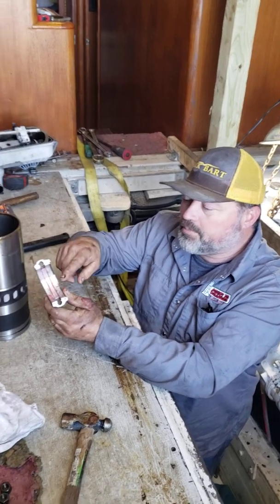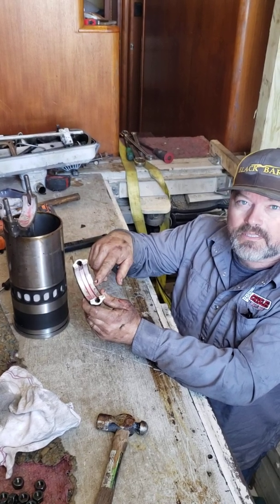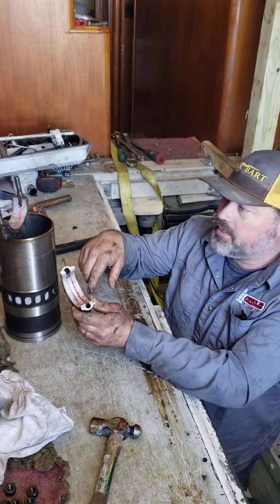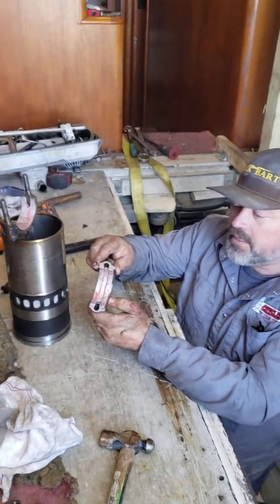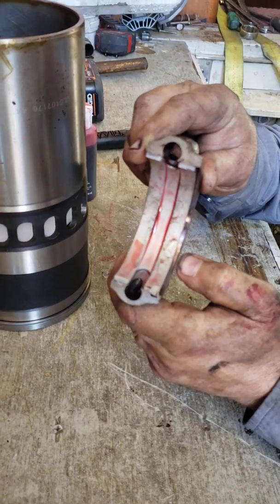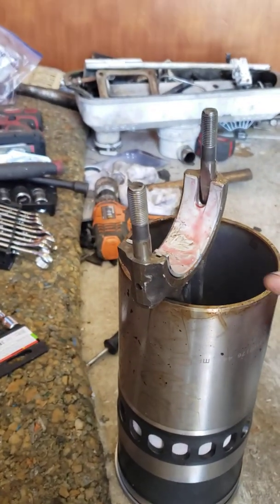Make sure that's right. Make sure you get the proper bearings — they're marked upper and lower on the backside. Make sure you've got the lower on the lower and the upper on the upper. They are offset a little bit, as you can see right here. They're made to be offset just a slight bit — same as on your rod.